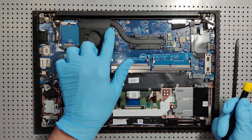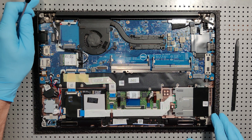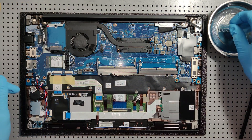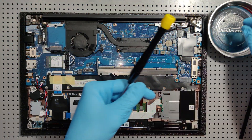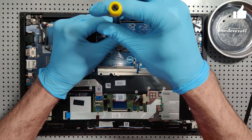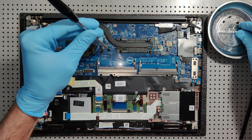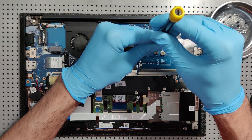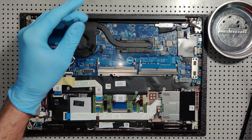Now I'm gonna remove these four screws and the CPU fan screw. Always a good practice: try and pick up one of these metal trays. This will help you keep the screws in formation — place them in the tray in the same way that you remove them. Looking back at the computer when you're ready to reinstall, you'll know exactly where the screws go. Note that sometimes these screws can be different lengths depending on your computer, so just to be safe.